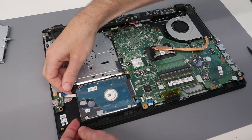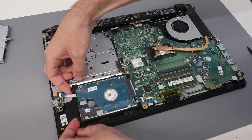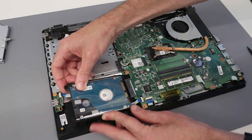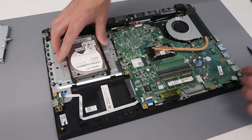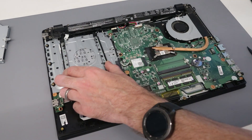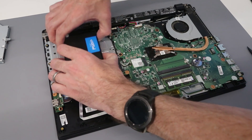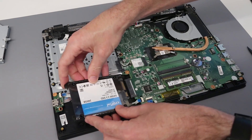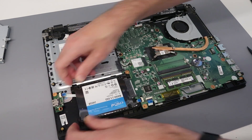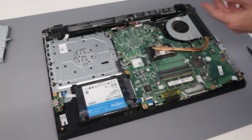What we are going to do today is lift the hard drive out. It's not screwed in — it's held in a rubber mount. We lift the end of the bracket and then gently slide the drive away from the SATA port. We can then fold down the sides of the bracket and position our replacement — in this case a Crucial BX500 240GB drive — and slot that back onto the SATA port and press down. While we're here we'll also check the fan.